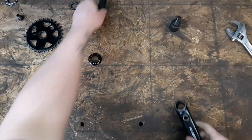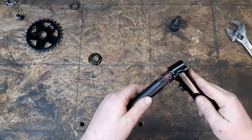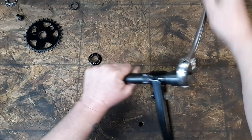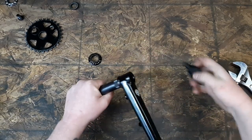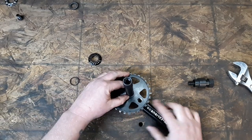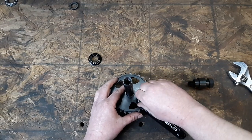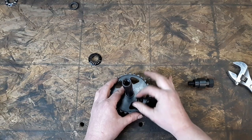I always start with my right crank. Take the center shaft, add a little bit of grease, start it on by hand. Thread in your crank arm installation tool — you just want to get this started well, really not even halfway. Once it's started, put on the sprocket — the adapter is already on there for the 22-millimeter — then the spacer. Go ahead and put on the bolt, and now we can move to the bike.